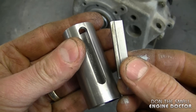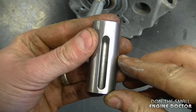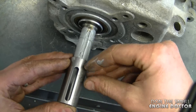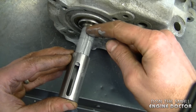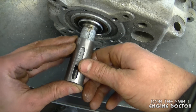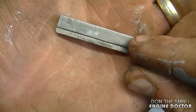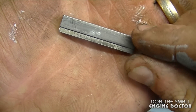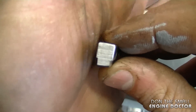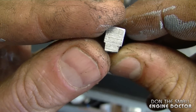You need to separate the key from the adapter. I'm going to install the adapter on the crankshaft in this position. When you install it you want to line up the keyway hole on the crankshaft and the hole on the adapter sleeve. Install the key facing down — it's slightly smaller on the bottom, which is the part that will go on the engine crankshaft.